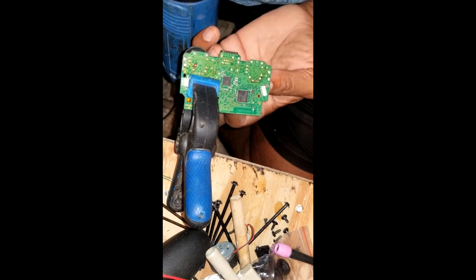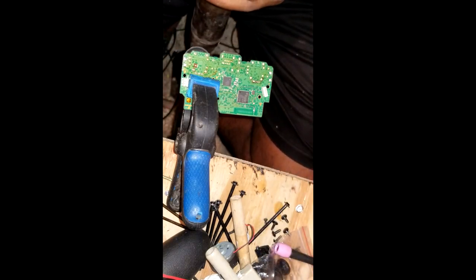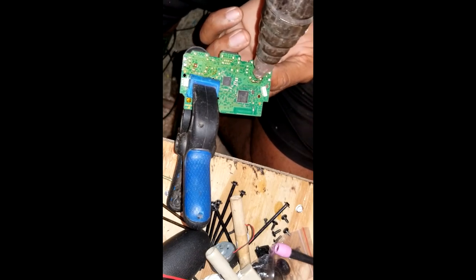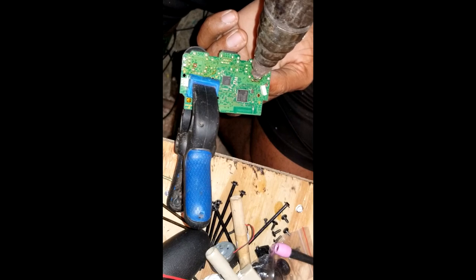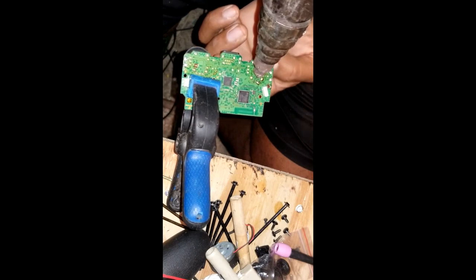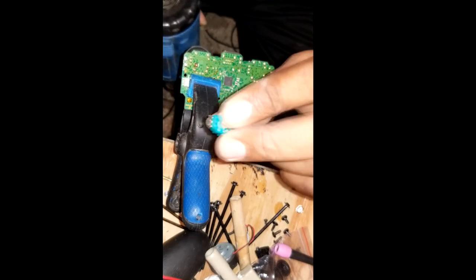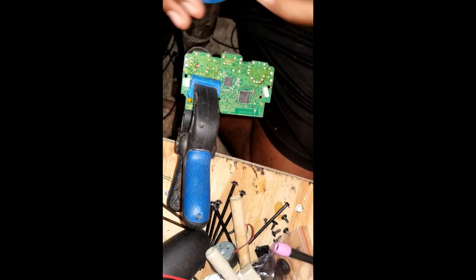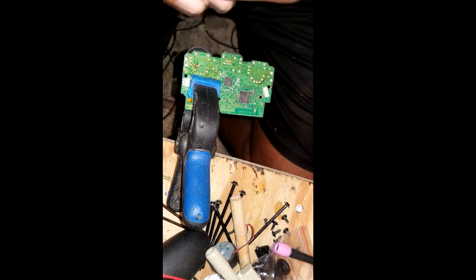What I'm going to do, I'm going to pull out the sensor, then use the solder sucker and then clean up the holes. Go. It's a little thing. If anybody knows where you can buy this alone without the whole complete analog, let me know in the comment section. Sometimes this is the main thing I need to change, not the analog, just this. Yeah, then I'm gonna put it back on, load it and clean out them all, you know.